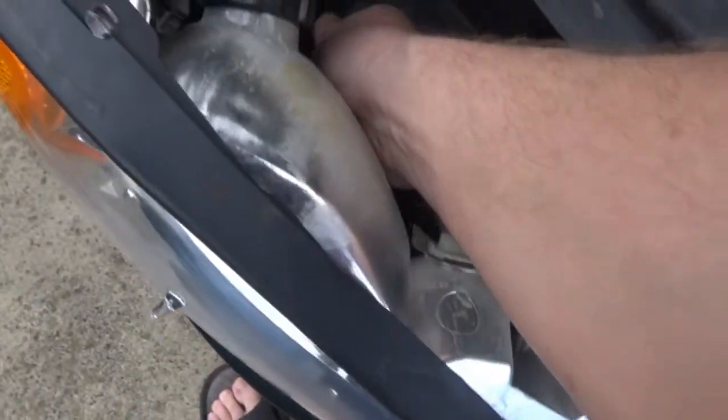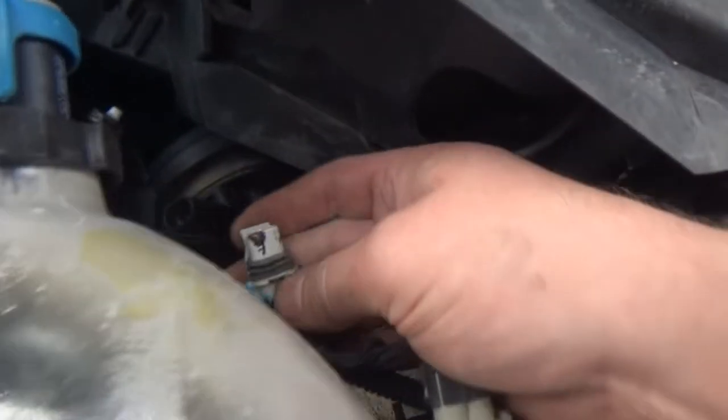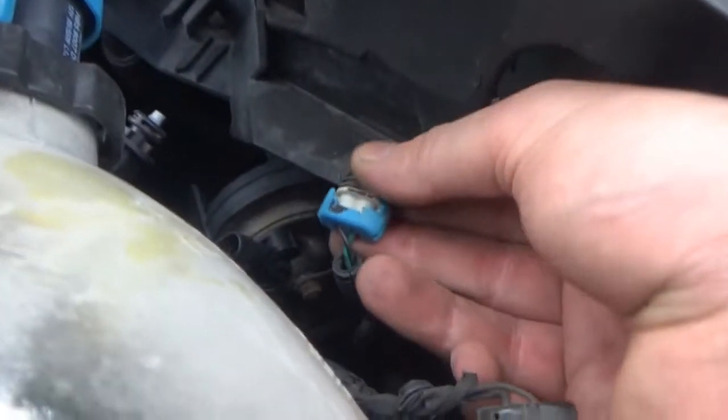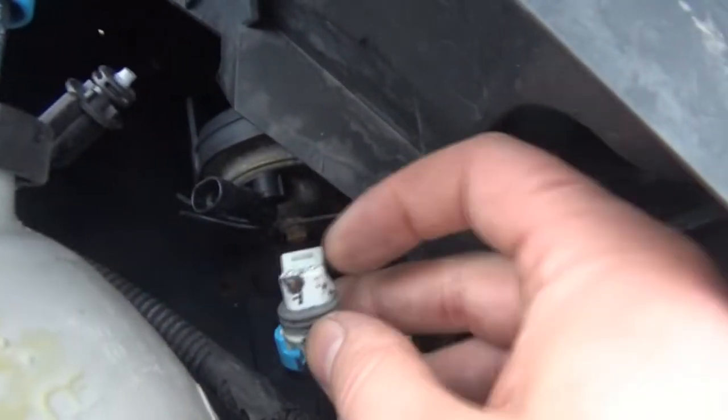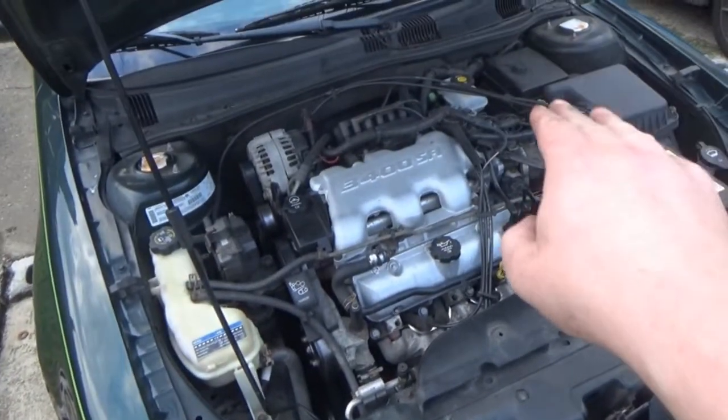So, we unplug it. Oh good, Julie's home. That means I can have her push the button. All right, so the green wire, which is going to this side, is going to be the power. The black one's obviously the ground. Let's not drop that. To really execute this, we have to hook our relay back in. If I plug the relay in and we hear it click, that means the horn switch has already been stuck. So, let me find this thing that I put down in here somewhere. Oh, nope, not there. There it is, on the seat.